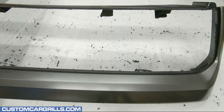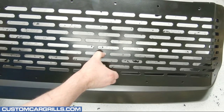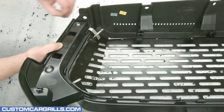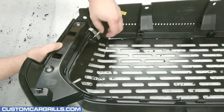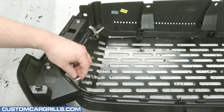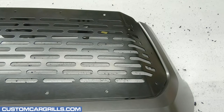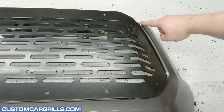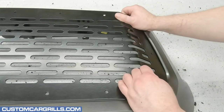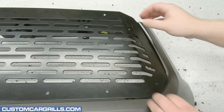Then it's time to get the new heavy duty grille center in place. This should drop right in like so. On the back of the grille, there's a couple threaded studs that will be used to help center it up. Included are some thick stainless brackets that drop on like this, and can be held in place with the supplied nuts. It's important to have equal spacing on each side so that the transition from the inner and outer parts of the grilles are symmetrical and seamless. This is the time to make any adjustments to those areas.